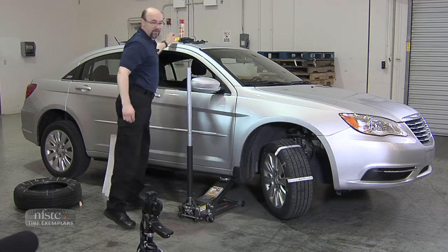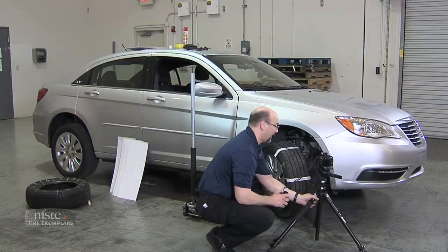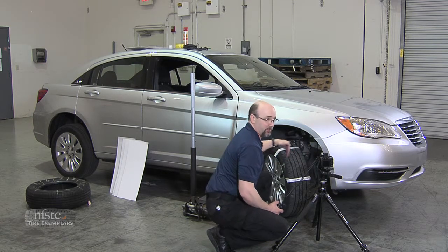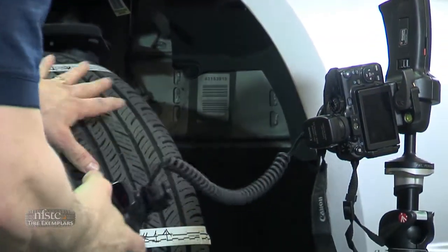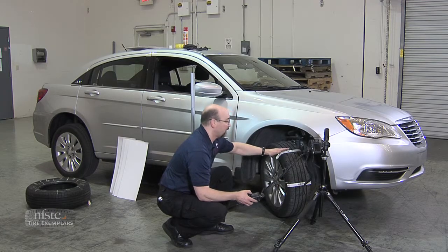It's important that I take my camera and fill the frame as much as I can. I don't want my camera in a horizontal or landscape position because I'm going to be wasting megapixels of resolution on either side. In this case I'll turn it straight up and down. I also have to make sure that my camera is parallel to this surface, and center it so I can take a photo from here to here.